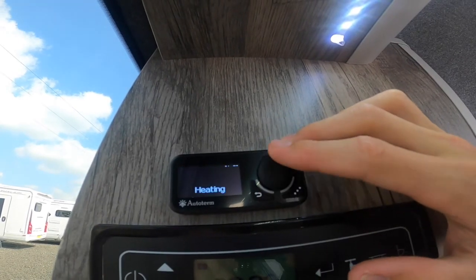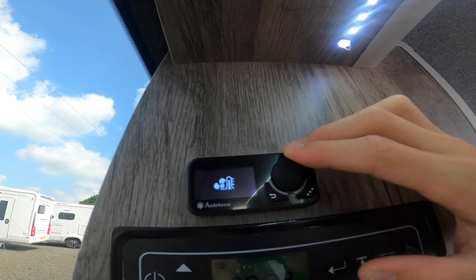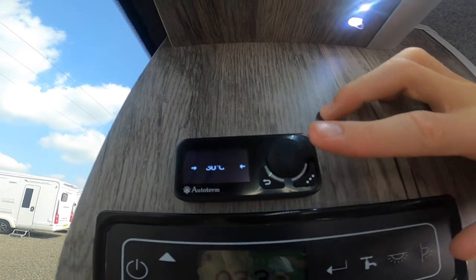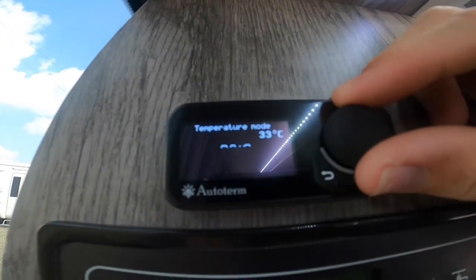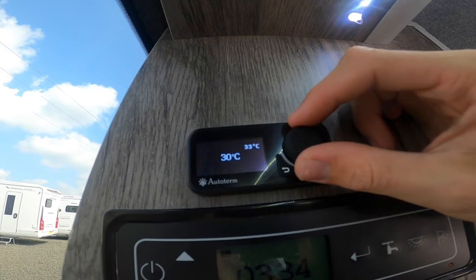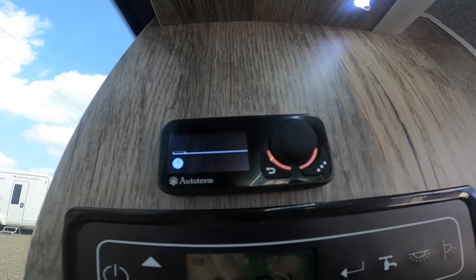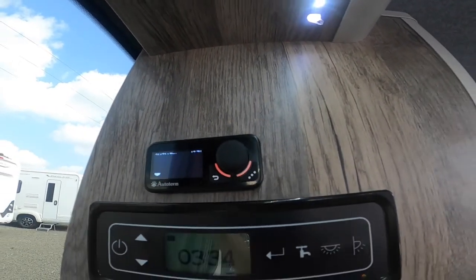You can set the temperature on heating — you've got temperature mode, power mode, heating, ventilation, and thermostat. In temperature mode, turn the temperature up and down to what you want — for example, max 30 degrees. You can also set a timer in five-minute increments: 30, 35, 40 minutes, and so on, or turn it all the way to off. To run the diesel heater you need to make sure you've got at least a quarter of a tank of diesel in the main tank, because the diesel heater draws from the main engine fuel supply — but it's set up so it won't drain the engine from starting should you get low on diesel.